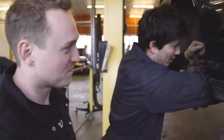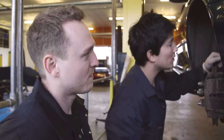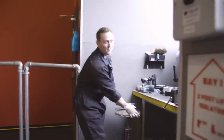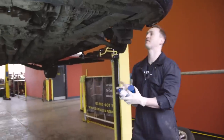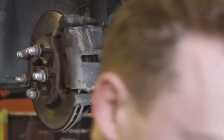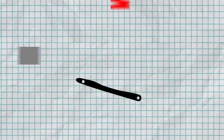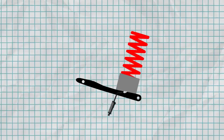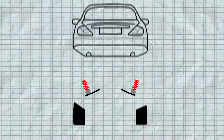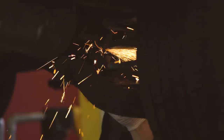I think hatred's one of them — so much negativity in the workshop. This is not what being a car guy is about. Everyone just needs to be happy, everyone needs to relax. With progress on the front suspension now hitting an Alex-shaped brick wall, Gareth starts on the rear of the car. At the rear, we'll be fabricating metal sleeves with an inbuilt platform for the spring to sit on. This sleeve and platform unit will then be welded onto the rear control arms, after which we'll bolt everything back up and bask in the glory of a 70mm lifted X-Type. The first thing to do is completely get rid of the rear anti-roll bar.